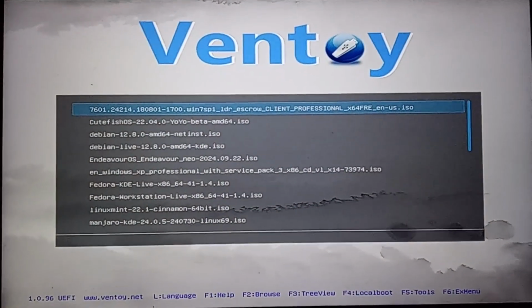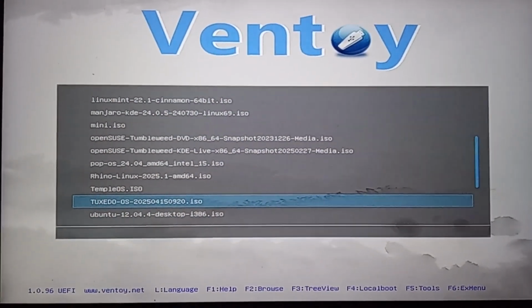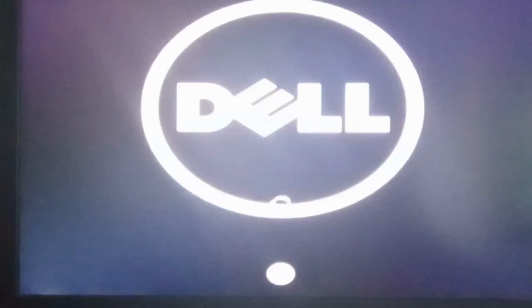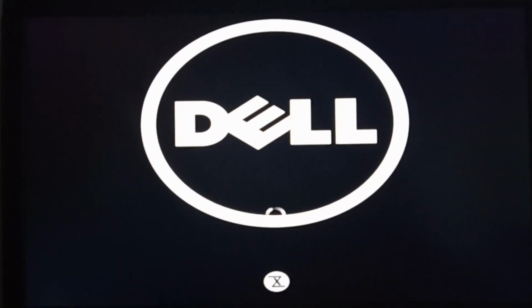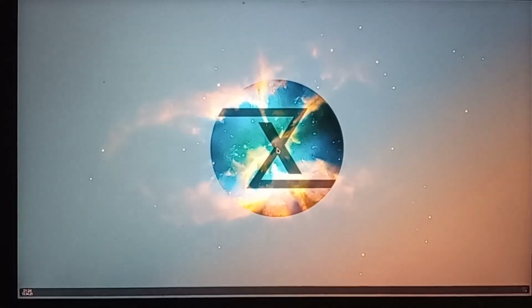If you choose a Ventoy drive, you get a list of all the ISOs on it and you can choose between them. If you flashed an ISO to the drive, it will launch that OS directly. One quirk I found with my Ventoy installation is that it starts with a rather small screen size, so the loading screen might look a little weird, but it doesn't affect the OS itself. Speaking of, at this point you enter the installer for the system.